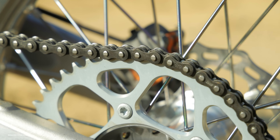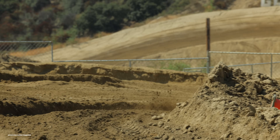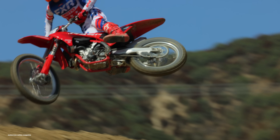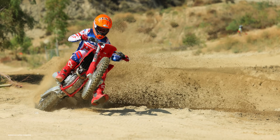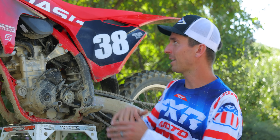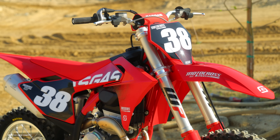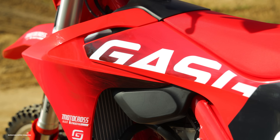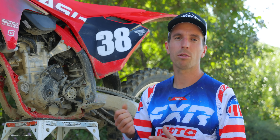This bike comes with a 52-tooth rear sprocket, up one tooth from the Husqvarna and KTM. Another difference: this bike has a more closed-off airbox cover. There is some air able to get through, but it's far less than the KTM. KTM has two grab handles up top, allowing lots more air flowing into the airbox cover and into the engine, which opens it up for more snap out of corners and more pop. On the dyno it doesn't make a huge difference, but on the track there's noticeably more throttle response with KTM.